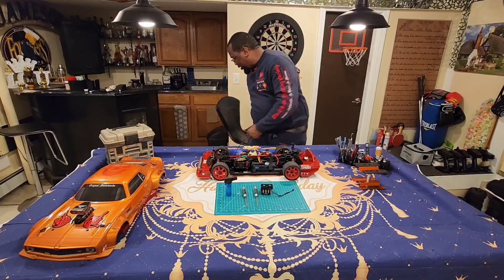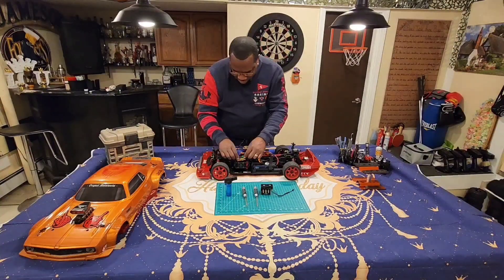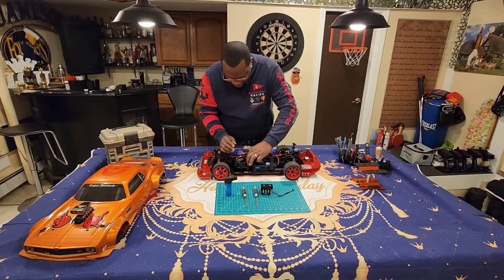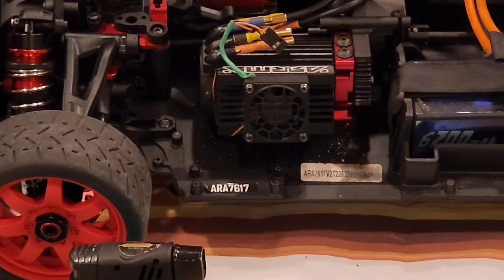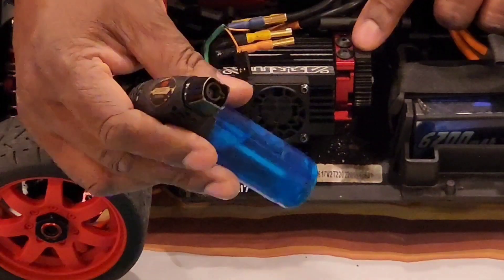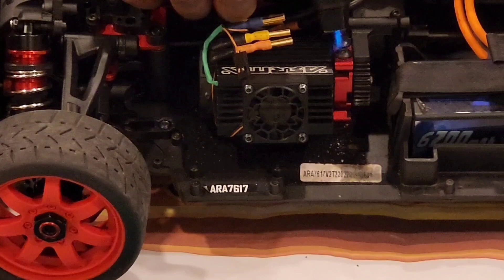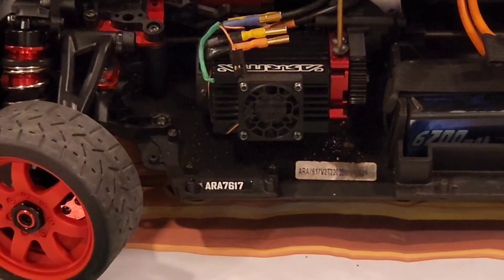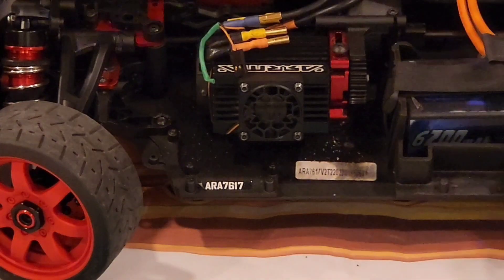Pretty simple — let me get this out of my way. First thing I'm going to do is disconnect all my wires. Pull the fan out — that fan is going on the Omega probably. Get all my wires out of the way, let it be open nice and pretty for you guys. These two screws right here are holding your motor in. Take your torch lighter, heat them up — not that much, just enough to heat the screw lock. Just enough to pop it off. Once you hear that click and she's moving, you're good to go.